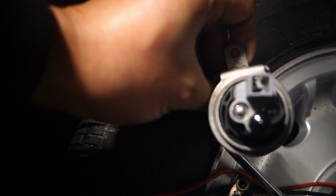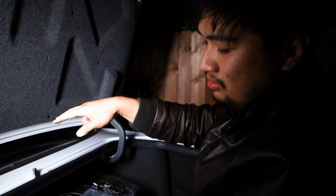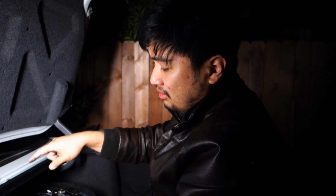The new pump is in the tank. I don't know if I mentioned earlier, but we used the pump from an F250 V10. We just have to put all of the hoses and stuff back and push the tank back in. There are two outlet and inlet lines at the bottom of the tank, which is honestly the worst part of doing this job, but now that we're not taking it off, it should be a lot easier to just put it back, because I guess they're called quick connect. Yeah, not quick disconnect for sure.